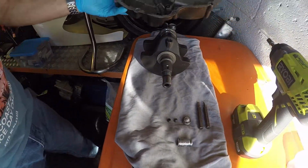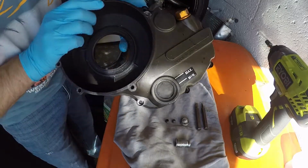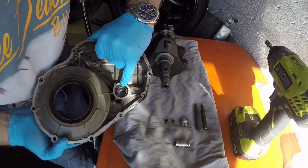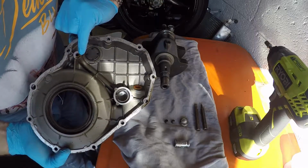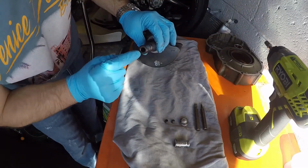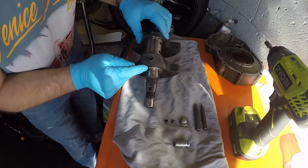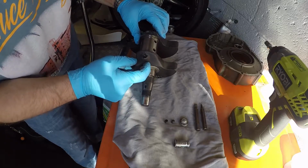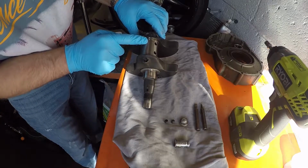So usually the crank end would sit in the clutch case side. It sits in this little hole here, and there is a channel right at the end there that takes this feed here that comes out of the oil pump, okay, when it's sat on the block. That feeds along into this hole here, goes along this channel inside, comes up the right hand web as you sit on the bike, goes into the main journal for the crank.